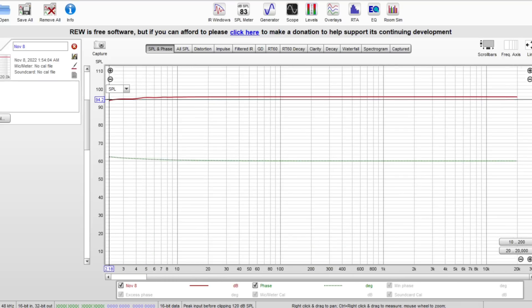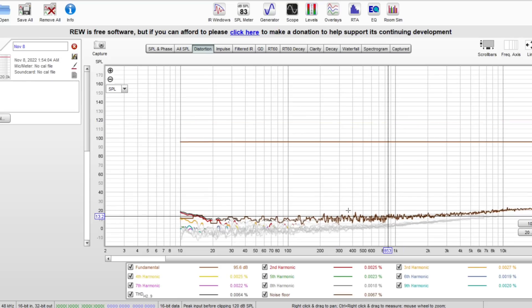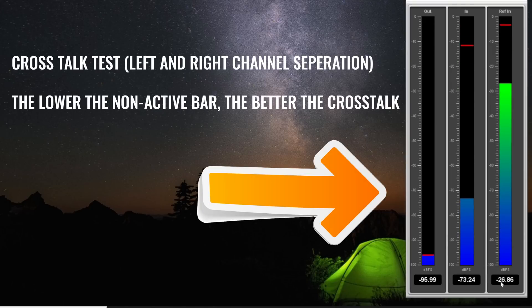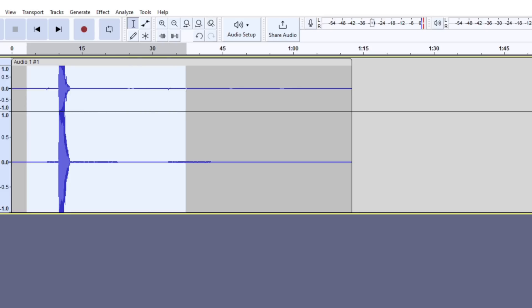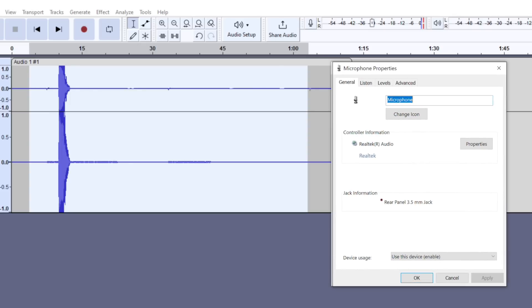The numbers were actually pretty good. The crosstalk was really low, closing in on minus 90 decibels, and the frequency response was really solid — we had a minus 1.6 decibel roll-off under 20 Hz, which is extremely good. If you've got some good mid-range headphones, they're going to pair up really well with this motherboard and give you relatively low levels of distortion. Now, the mic-in port features heavy noise suppression, so if you're looking at getting dedicated audio recorded on this motherboard, I would suggest getting a separate solution.